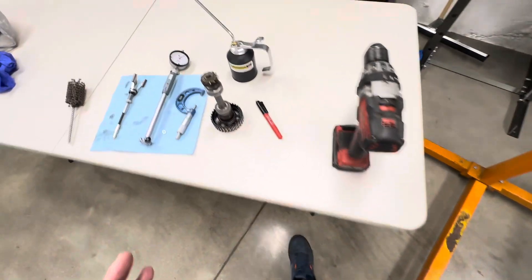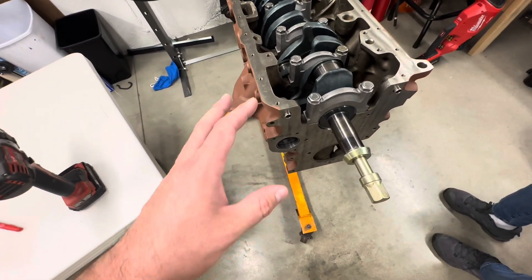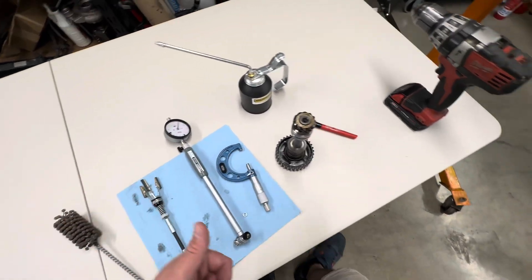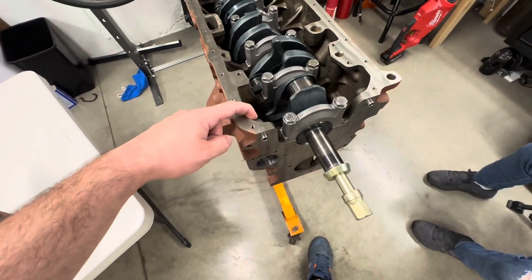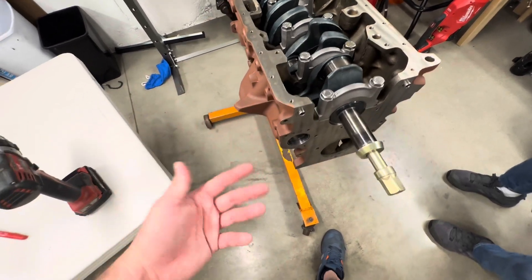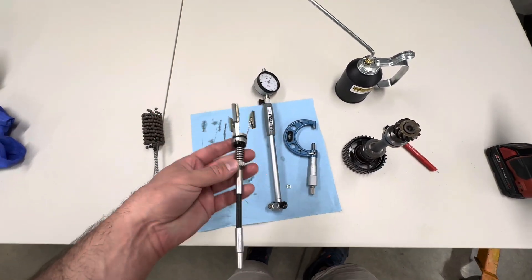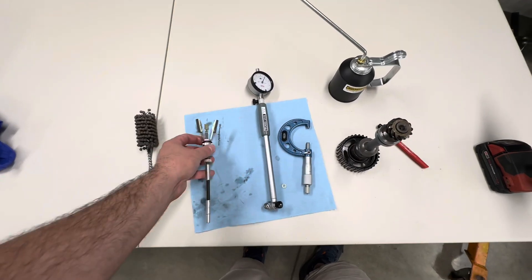I had a whole other bunch of videos I was going to make on this of me actually drilling it out, but I got so tied up in the frustration of everything I was working on that I just figured I'd do kind of an aftermath. If you're looking to do this, it actually isn't too difficult. Hopefully it works really well — yet to go fully together, but I do have them within the factory spec. I think factory spec on both of them is anywhere from 1.5 thousandths to 2.5 thousandths, so kind of like a standard bearing — a lot of the bearings like main caps and rod journals are that same spec. I'll throw this tool in the description. It's basically the same that you would use for a brake cylinder — if you're honing a brake cylinder to rebuild it, that's what this is: the brake cylinder hone.